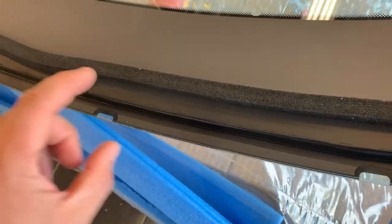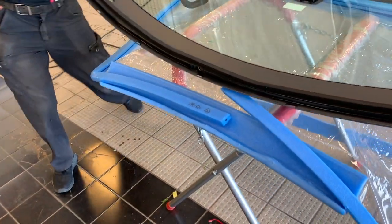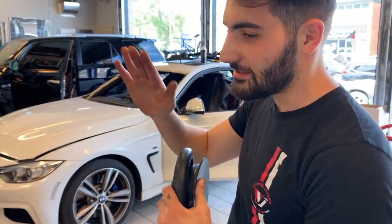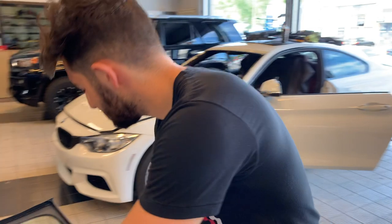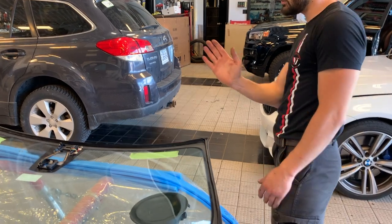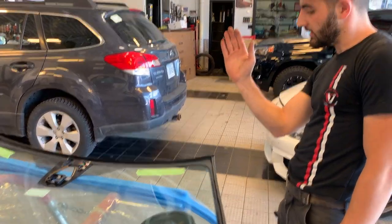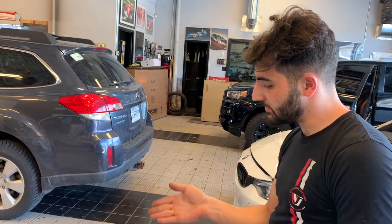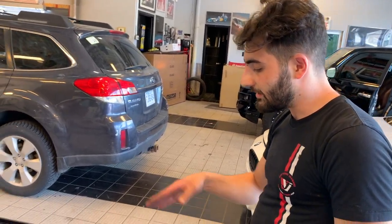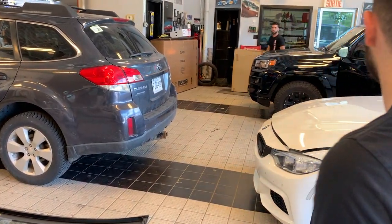Keep it always between the two lines along the entire windshield, just inside those two little lines. And the angle is important, maybe 80 degrees towards the frame. See, this is it, it always looks a bit towards the frame. If your retaining line is towards upwards, when you install it, some part of it is going to go on the molding. In the future, if you ever want to save the glass, it can even cause bad adhesion, and therefore it could make water leak in the future.